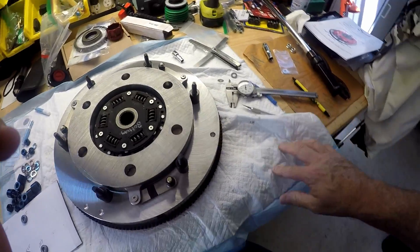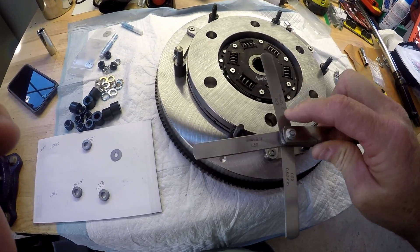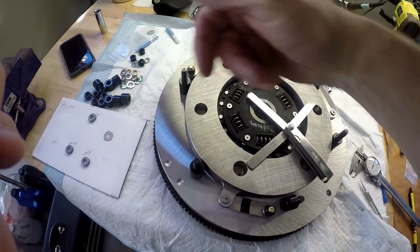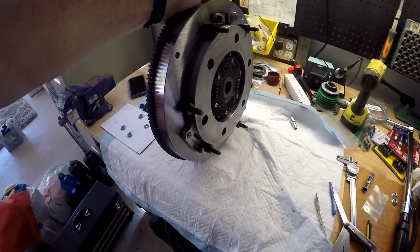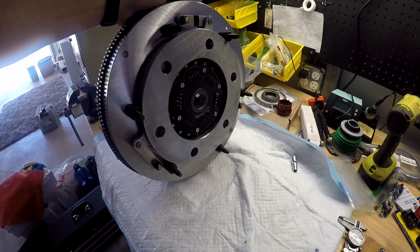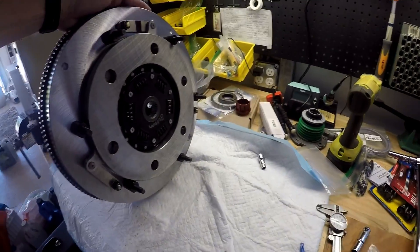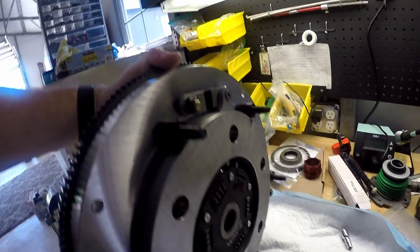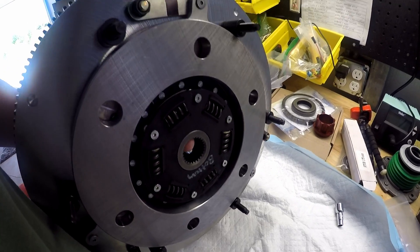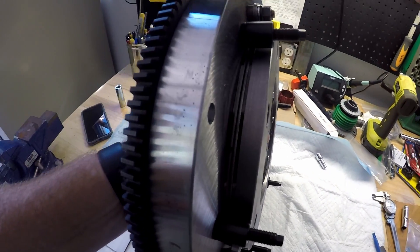With these tightened down, this is in its neutral position — it can move and pull up and down a little bit. We're going to take the feeler gauge at 20 thousandths and find the 15 and maybe the 12, clean them up, and start checking that gap around to make sure we're okay. Another test you can do to make sure the bottom disc is loose enough is to stand it on its end — the floater plate is torqued down — and take your finger, put it inside the splined hole, and just lift up on it.